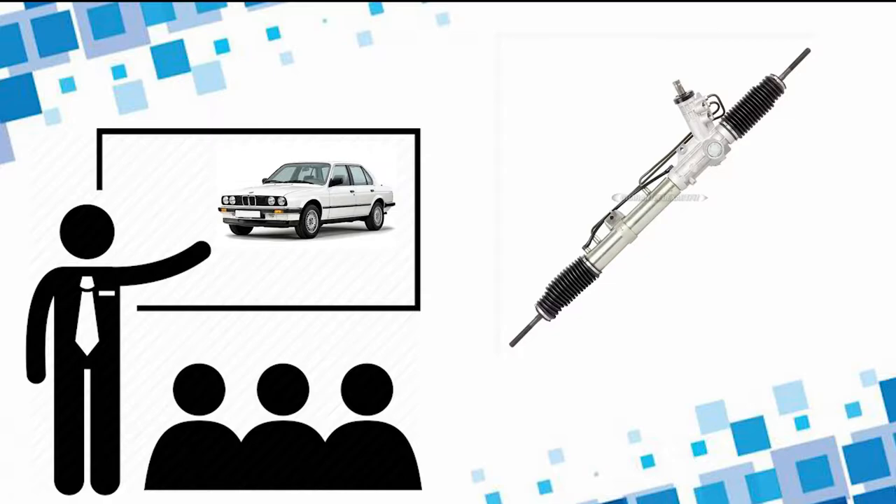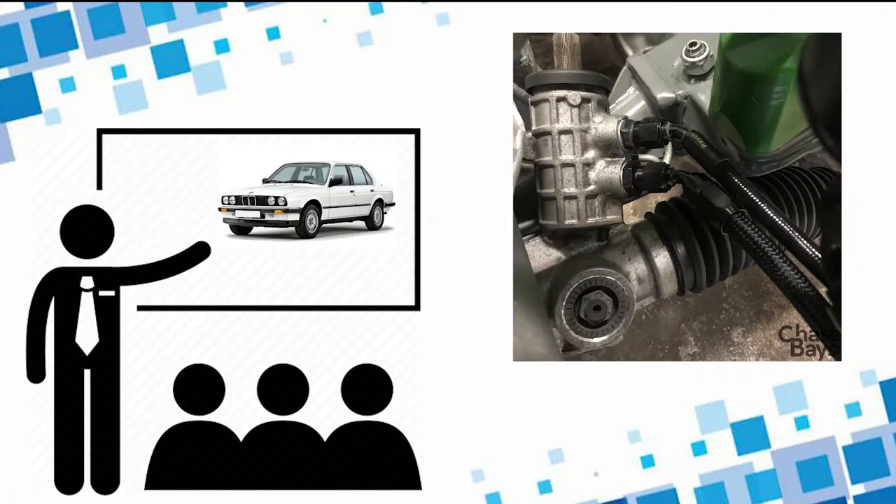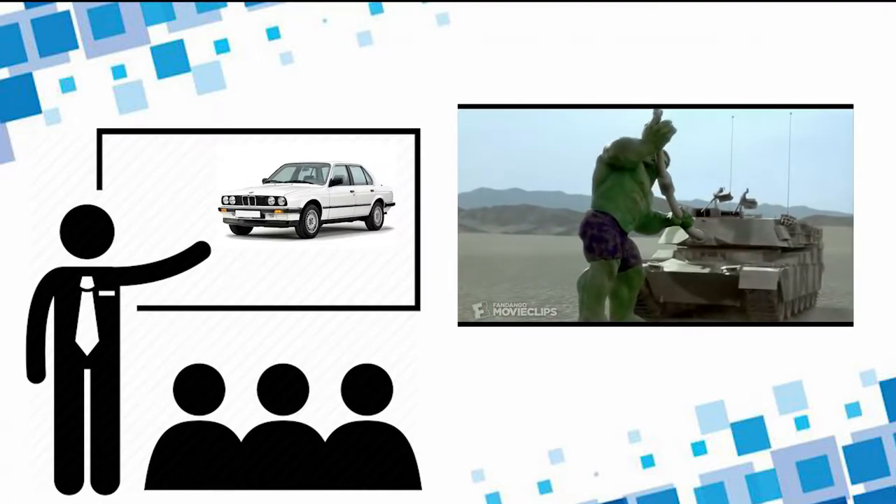Hopefully this will be done today — let's get to it. I apologize in advance because everything recorded after this is going to be trash, so I'll go over this briefly just to cover it in case I missed something. I recommend draining the power steering fluid beforehand to minimize the mess during the swap. I also recommend getting new power steering lines — Chase Bays has a kit that works perfectly, though at the time of this video they are out of stock. It's still a good recommendation because bending the lines is super difficult.